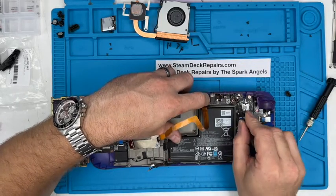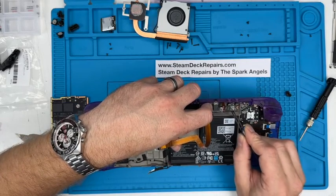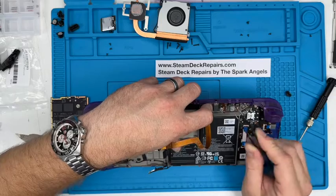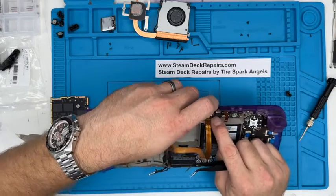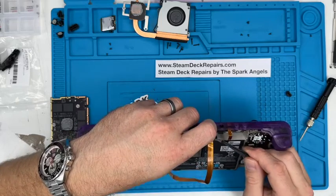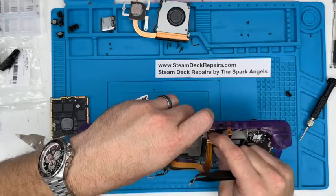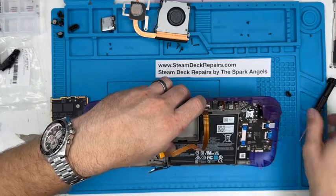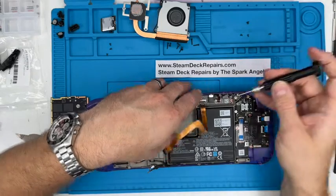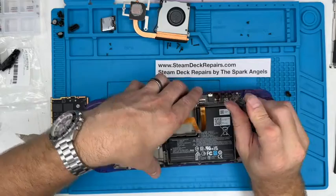Lift it up a little bit. You've got these two little lugs that sit on top of these micro switches. Again, we replace those micro switches if you have an issue with your volume or your power. We don't replace the whole board, saving you money, and it's not wasteful. We know that that's still in place, and there's that bit of tape there. So we're just going to push it in a little bit and then stick the tape down, and that fold is where it's naturally finding its way, so that's good. We put a couple of screws in this daughter board, in this audio board.